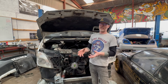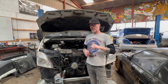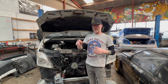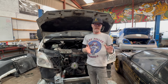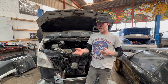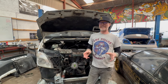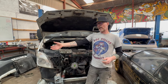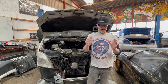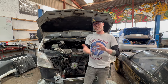Obviously, because we've lost a load of sensors that the ECU is monitoring, the check engine light comes on. Now there is a way around that — not a piece of tape, though you can put a piece of tape over it if you want. But we want to know if there's a crank angle sensor problem; it will bring the light on, and we can find it live through the OBD plug. The four things I'm monitoring — you want them to put the check engine light on if there is a fault. To get rid of all the ones that are obviously faulty because they're not there, you need to find a decent mapper. They will take the map out, look at it, and you tell them to delete every fault code that is showing right now. They'll get rid of those lines of code. The dash engine management light should go out, or should come on when you put the ignition on and then go out because it's only then monitoring the four things.